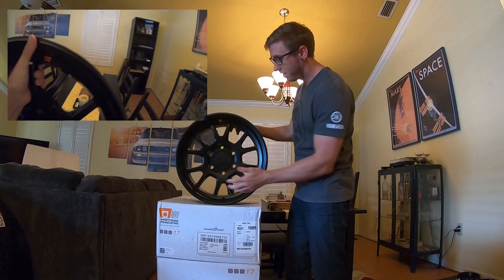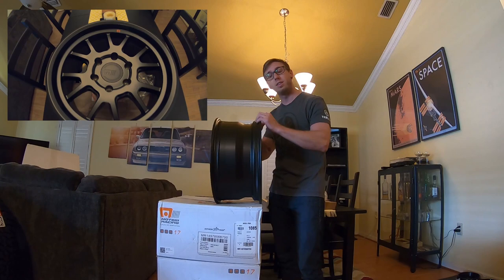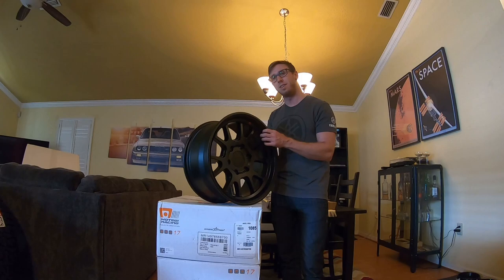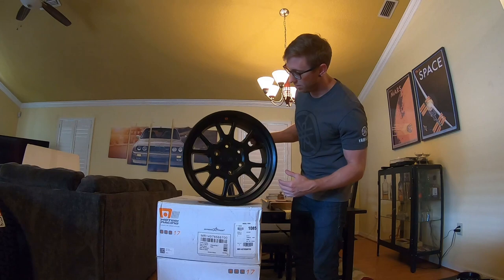Like I said, with the 17 inch diameter with an 8.5 width on these. I had been reading and it's recommended that you go with 8.5-ish or 9. I see some guys putting smaller width wheels with the tire setup that I'm going with, so it shouldn't be an issue. I didn't want to go with exactly 9 because once I started seeing some examples with a larger tire on an 8.5 wheel, I saw the nice rounded tire once it was inflated, and I thought it would give it a more aggressive look. So this is why I went with it.